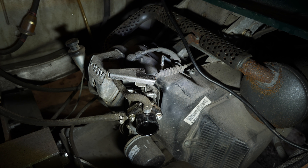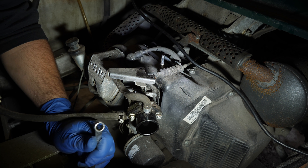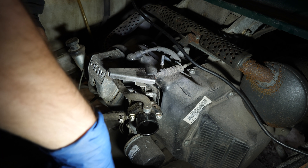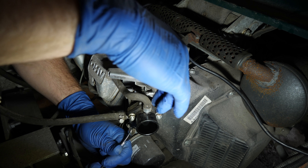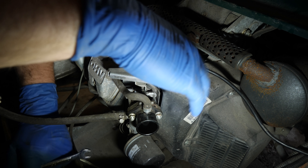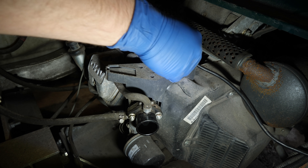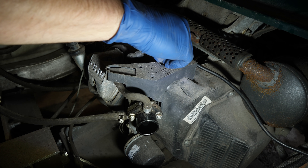The governor is bad in this cart, so we have to be very careful. The best I can do is get it close — it's never going to self-regulate. It will always be manual throttle control. This is the problem when you watch YouTube videos on how to adjust the governor to make your golf cart faster and you blow up that governor. Your engine will never operate properly again. If I have to put a rear end in this cart you're looking at a couple thousand dollars.